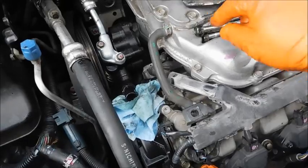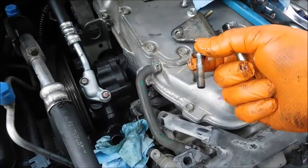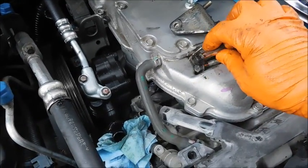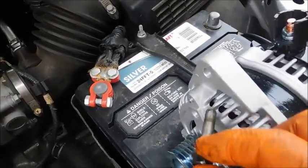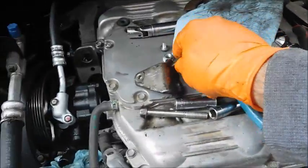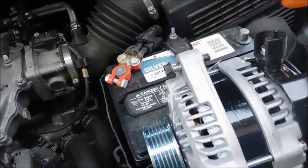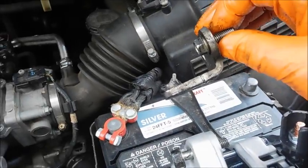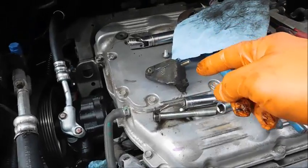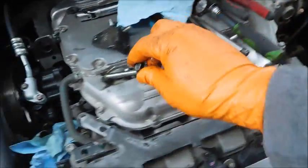The two bolts that hold the alternator to the engine are a 14 millimeter on the bottom and a 12 millimeter at the top. Now, that 12 millimeter went through, if you look at this new one over here, this top hole, and then this bracket created the backside or the nut. So this goes like that, and then this bolt attached it to the engine block. I just took the whole thing out of the way. The instructions had said to remove the bracket from the engine and leave it on the alternator, but I think it's going to be easier to separate everything.